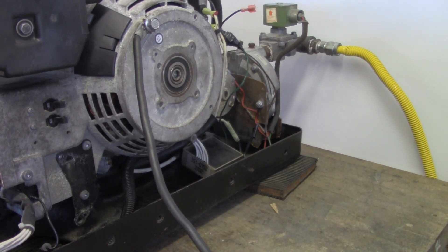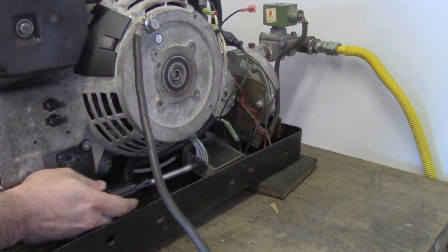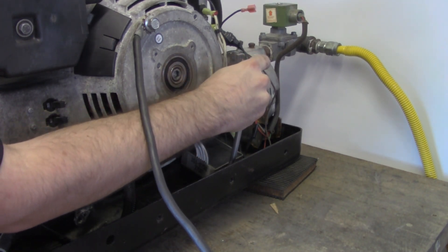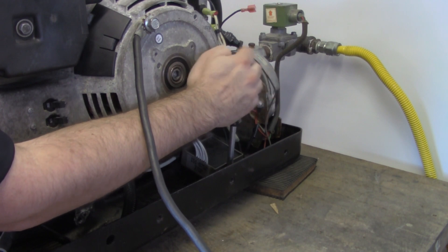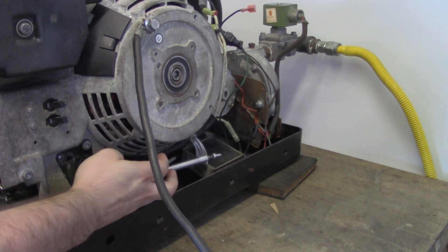The governor control is back there, and when you have this thing mounted in a coach, it can be pretty painful to get to. Just to give you an example of how you're going to end up grabbing it, I'm going to go through like you would in a coach — I don't have access to the sides. Hopefully you'll be able to stand the screwdriver up on end like that with the T25, and just walk the screw out. If you can't get the screwdriver in there like that, you're going to have to use the ratchet. Getting the regulator out of the way first is going to be the way to go.